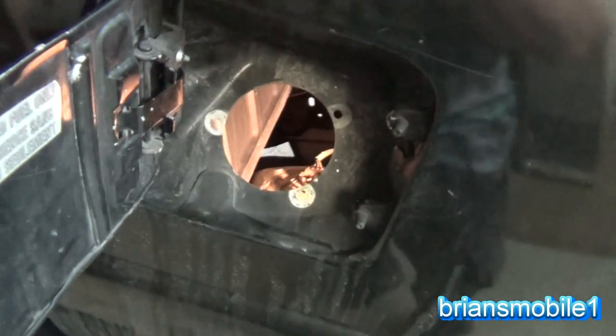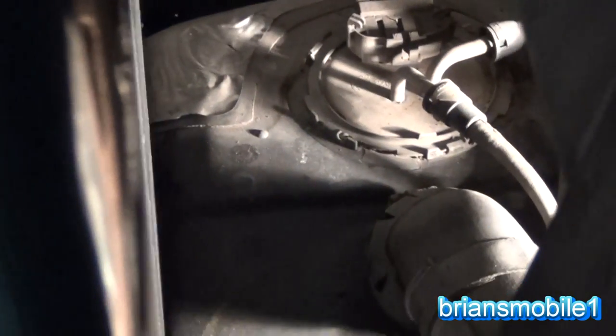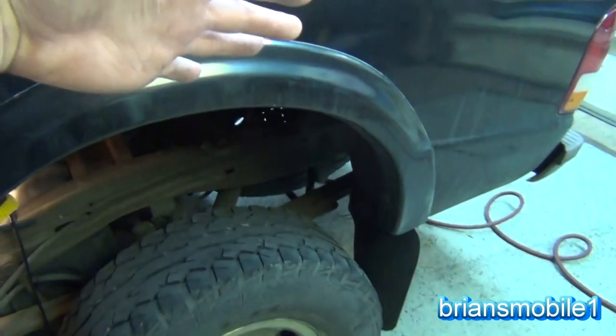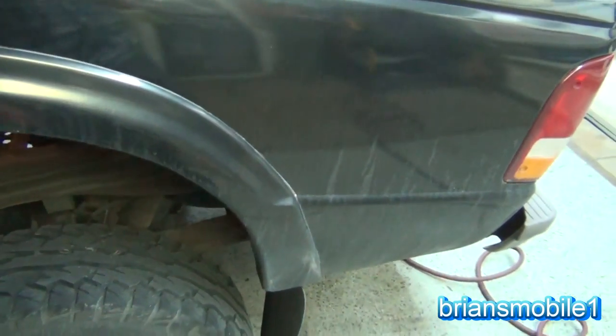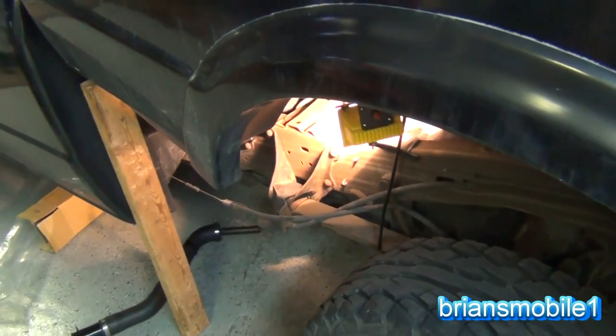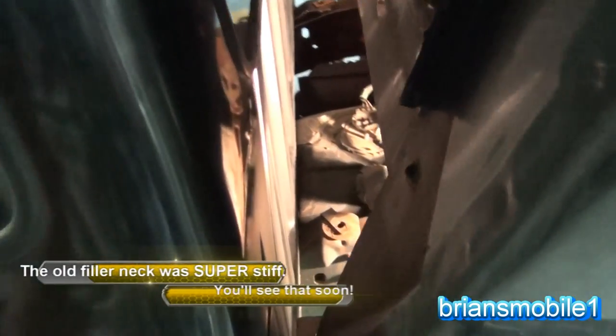You've got three little bolts in here that you have to undo the filler neck in order to get the bed to tip up like this. The main attraction here is the filler neck. She failed the safety inspection because her filler neck is spilling gas out over the top of the tank — she'd fill it up all the way and it would just spill out everywhere. Of course she's got a gross EVAP leak, and that is just a big one. I did this tilt thing — just grabbed it from one side because it's just a little Ford Ranger. I'm a big guy and tipped it up. The reason I didn't tip it sideways like the Chevy is that the taillights wiring on this thing is a mess — aftermarket trailer wiring and days of zip ties. The reason I didn't drop the tank is because you'd have to undo the filler neck, and this one's kind of a pain. After doing this tilted bed method, aside from the bolts being hard to get out, this is definitely the way to go.